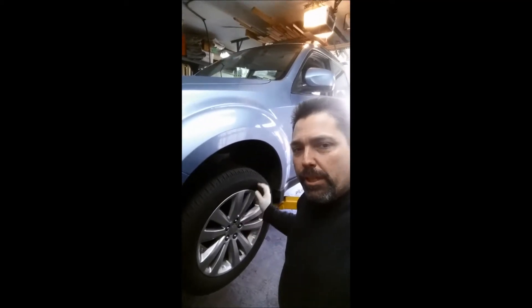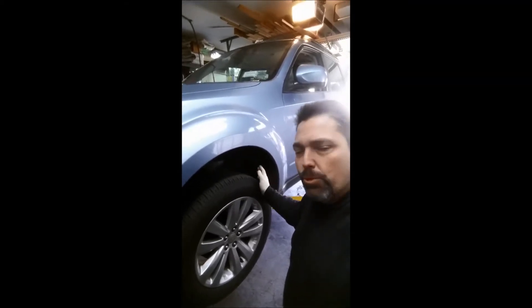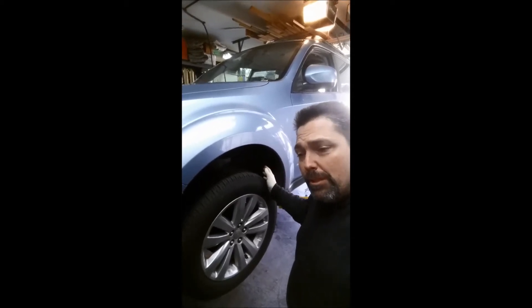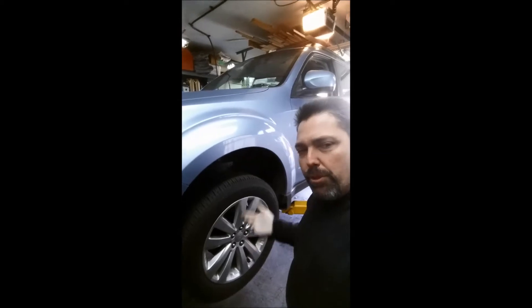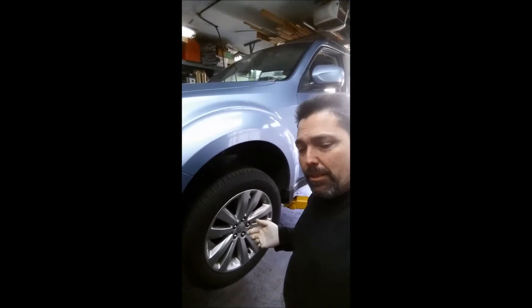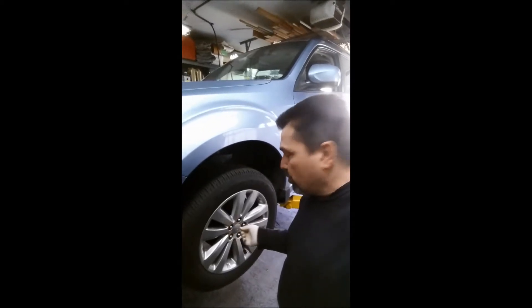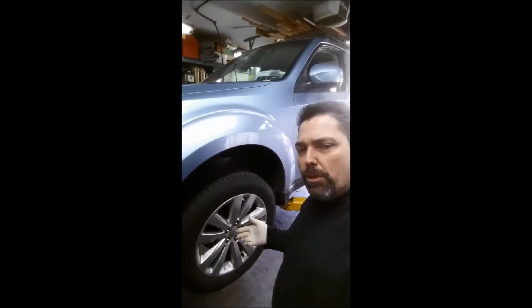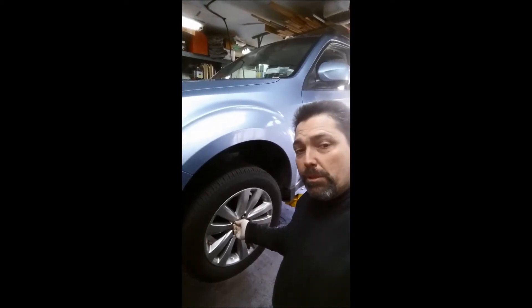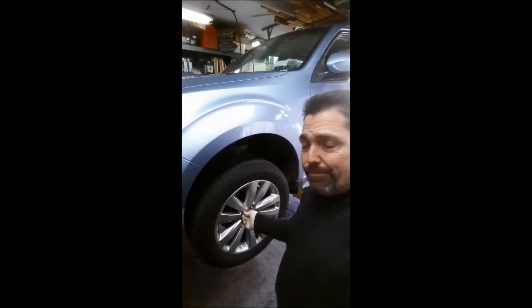What we've got is a 2011 Subaru Forester — it really doesn't make a difference what the car is to a point. Wheels are wheels for the most part. Taking the wheels off by hand is great, using a gun is fine too. The issue is really putting them back on. Yes, you can damage lug nuts from repeated air gun use — they can swell up. We have issues with chrome covers swelling. If that's the case, do yourself a favor and get new ones.